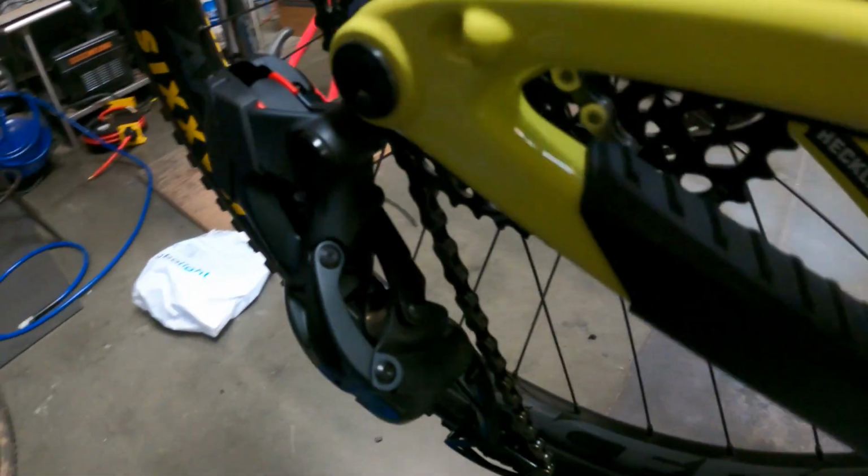You're gonna want to drop this chain, and it's tough to see with the camera, but basically right through this wheel, and there's this little bridge here, you can hardly see it right there, but you're gonna want to go right down through both of these guys here. So through that bridge and on the back side of this wheel through that little bridge there. And then once you clock the derailleur back into place, you will be good to go.